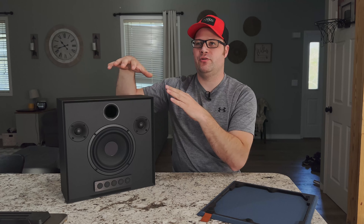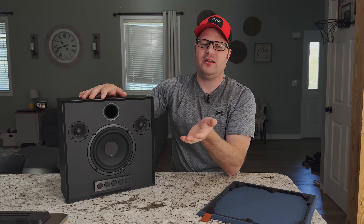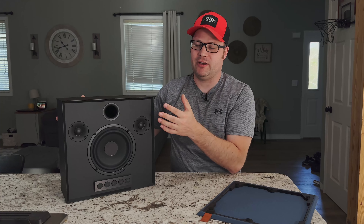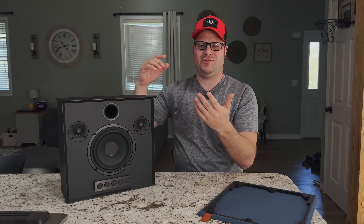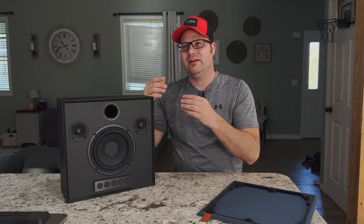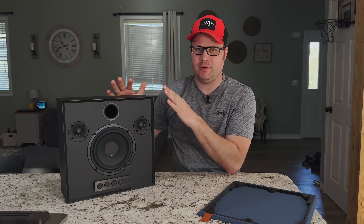There is a little bit of an issue with it being so linear. Most Bluetooth speakers really increase your bass and mid-range, and then have the high end tailing off a lot sooner, which makes them more forgiving in where you put them. So you can place them in a highly reflective room and it won't sound bright. This particular speaker though — when I did put it in my kitchen, which has granite countertops, all wood cabinets, metal stove — it did sound bright every once in a while. And that's because of the reflections of the room and not necessarily the speaker itself.